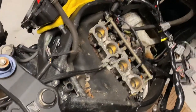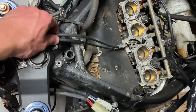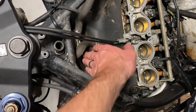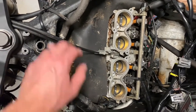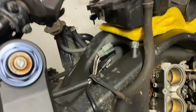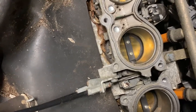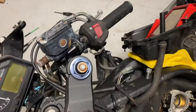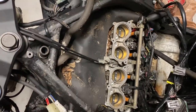Just to provide a little update of where we're at — I got the airbox completely removed. Now you can see we've got access to replace our throttle cables. I'm going to close up the throttle body ports here just to keep from getting any debris in here. I've been cleaning as I go but you can see I've still got leaves and stuff — the deeper I go the dirtier it gets. The reason I wanted to replace these throttle cables is it's just rusted really badly, and also the throttle is really hard to twist. You can see it's just barely moving the cable here, so you've got to really crank on it for that to open. I'm going to go ahead and get started on this — I'm hoping that when I swap the cables out and replace this whole right-hand control, this is going to be moving a lot smoother.